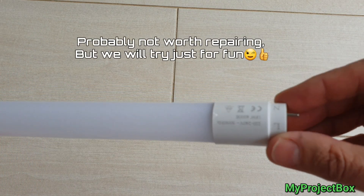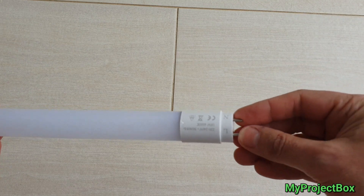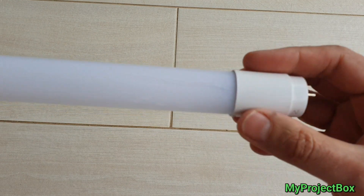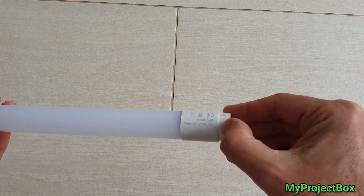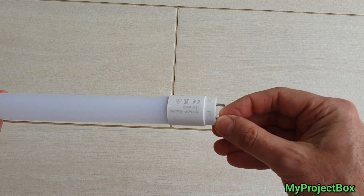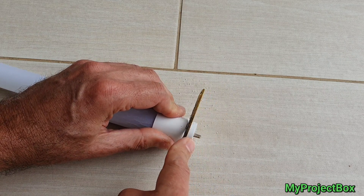I've replaced it with a better quality one, but normally I would try and pull the end cap off since the driver would be behind there. But it's so fragile it started to crack — all the plastic is cracked and so brittle. If I try to pull that off, most likely all of it would just break. So what I might do is hacksaw this off carefully and see if I can get to the driver that way, then just glue it back together if I can repair it.